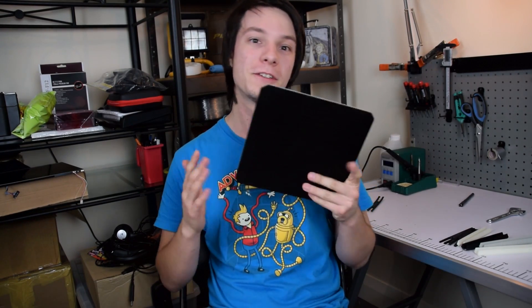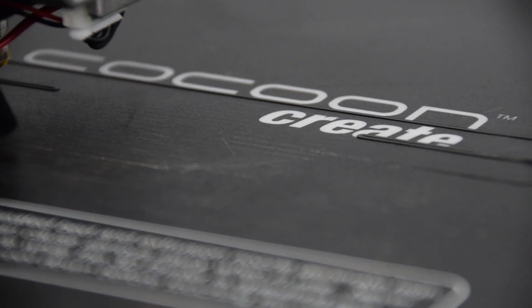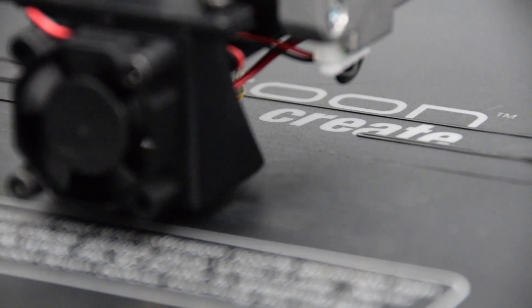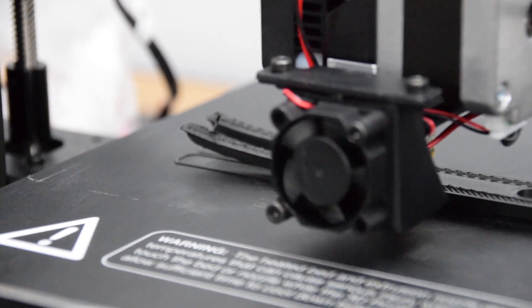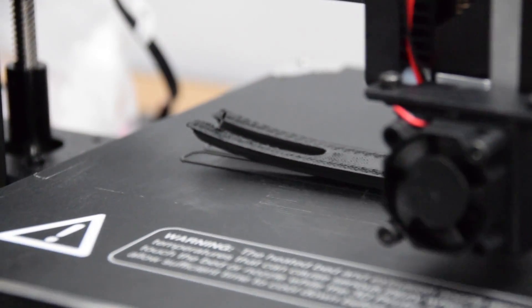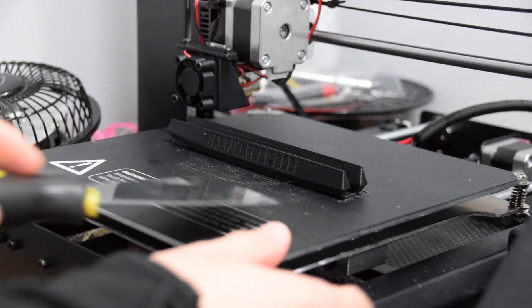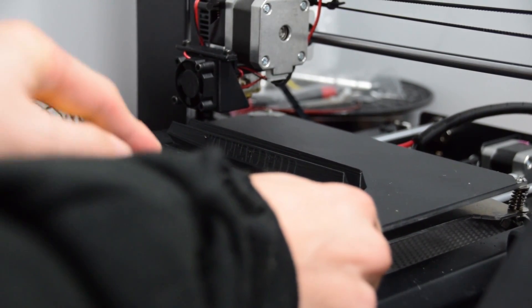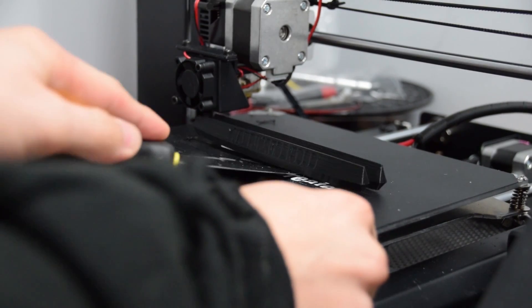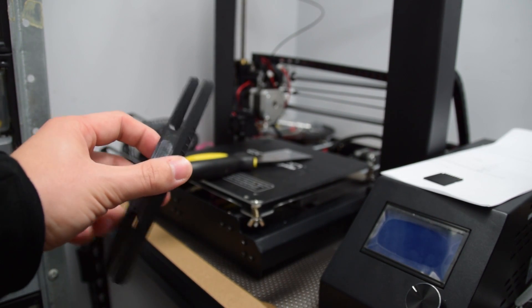You put the Zebra Plate on with bulldog clips and remove it afterwards, then flex it separately from the printer — meaning you don't have to worry about wrecking your bed level. One big plus. In terms of ABS on the stock BuildTak-like surface, that was a different story. I first tried 90 degrees bed temperature and it warped pretty much instantly, so I killed the print. At 100 degrees it did pretty well — not a bad print, but still warping along the edges. I think the Warpinator 5000 might be a bit too cruel for a stock Wanhao.